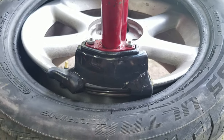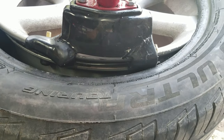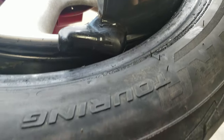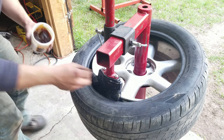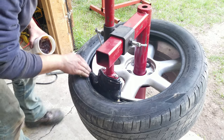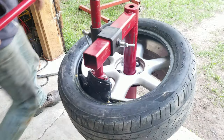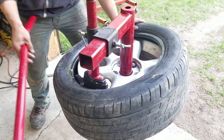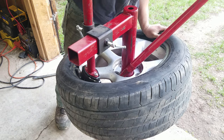To show what I was doing wrong — this is what I was doing when putting tires on. I was forcing it on with this edge, and it kind of pinches it, which is why I was struggling so much no matter how much lube I used. Now, if I'm correct with the information I was given, this is what it should look like going on. It should be going over the nub on that side and under on this side — that's actually what will push it on. First and foremost, obviously, get it nice and lubed up. Let's get this in position above the nub, below that one, get it on as much as we can over here.